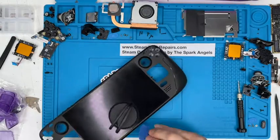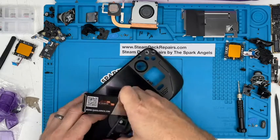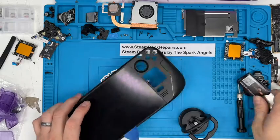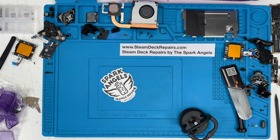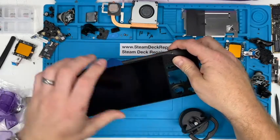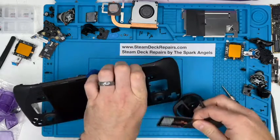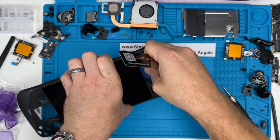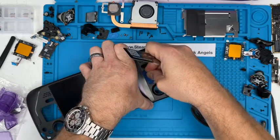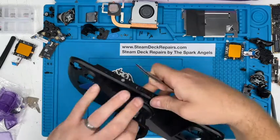I'm going to use a plectrum there. Break that off. I'm going to put that back on the heat just to do the last half of the screen, so I'm not forcing it. So we've re-warmed it a bit. Give some purchase down the other half of the screen, really. Let's start in the centre of the back piece.